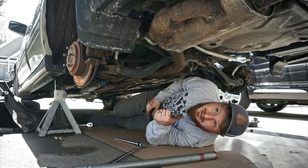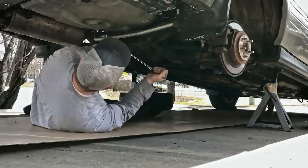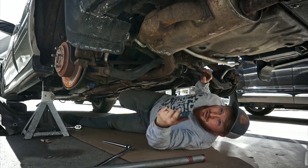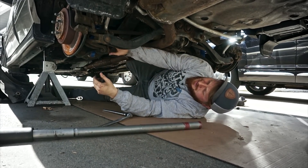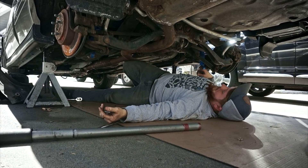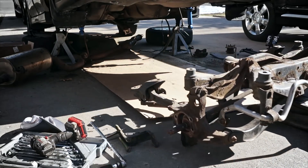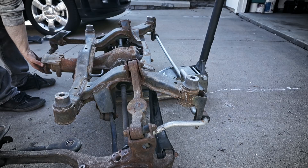I was just loosening all the bolts I could while it's still attached to the car, where I have leverage, breaking all of these that are kind of rusty. The subframe is only four or six really huge bolts. So what exactly is the subframe? The subframe is what all of these suspension arms and everything bolt to, which then bolts to the body. I'm taking off the whole back half of the car basically - all of the suspension components will come off with six bolts because it all drops down together.